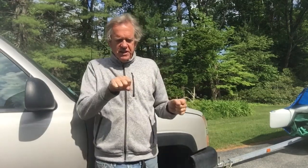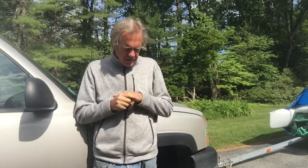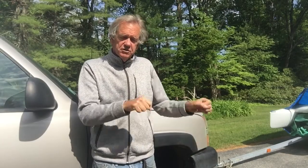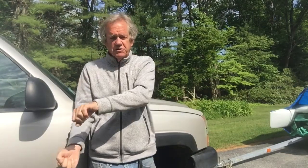I found another video that explained that if the noise changes as you're going down the road and you turn to the left or you turn to the right, that'll tell you which side the problem is on. And so I did that, and when I turned to the left, the noise went away. I'd go straight again, the noise would come back. If I turned to the right, the noise would stay there.